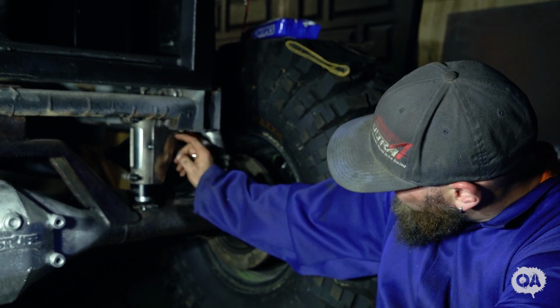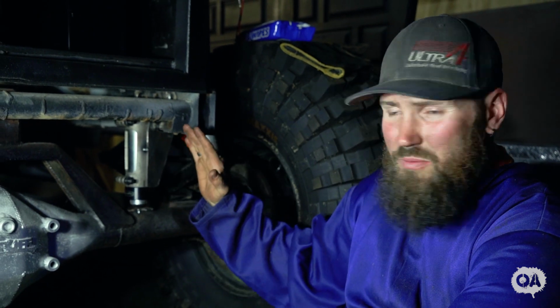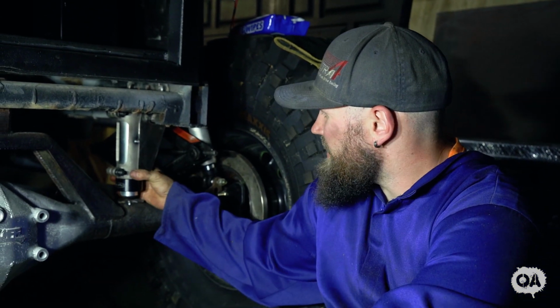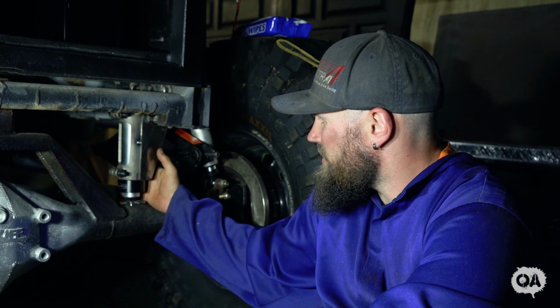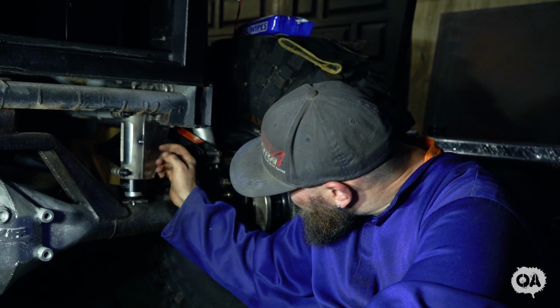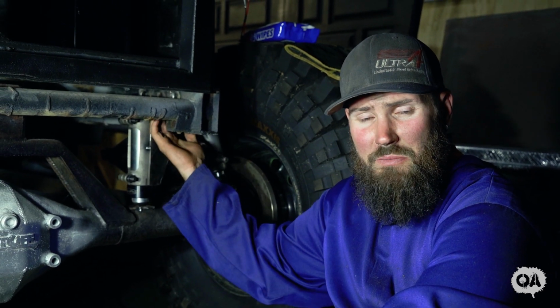The reason I've done it like this is because it's going to take all the vertical load, and I've made the plate come back and stretch the width of the chassis as well, because there will be a little bit of side load as the axle is getting crossed up. Apart from that, it's pretty straightforward. Just got the bump stop cans to weld in, and I've put a small fish plate on the inside of the chassis rail to take some of the load.